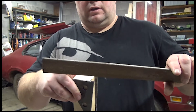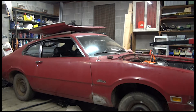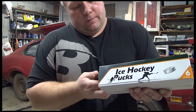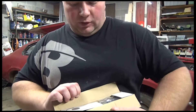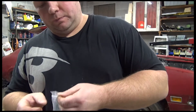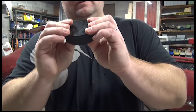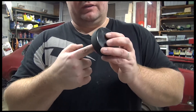I'll cut this off, drill a hole in it, and weld this one to here. Then the motor mount is actually back here. If you're a 240 guy, I'm pretty sure you know where we're going with this. In the 240 world, you can take your motor mounts out and actually use two of these. Here's a hockey puck. The material a hockey puck is made out of has a little bit of flex to it, so what you do is drill a hole through the center and use it for your motor mount.